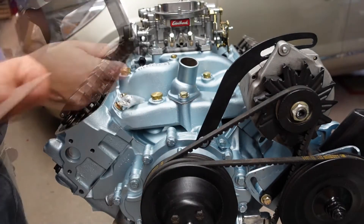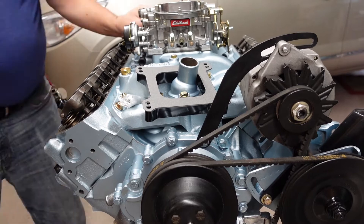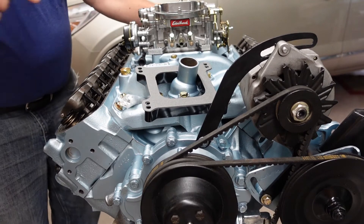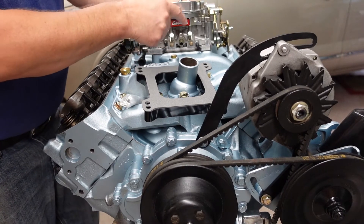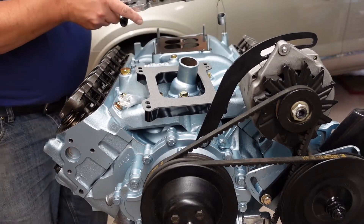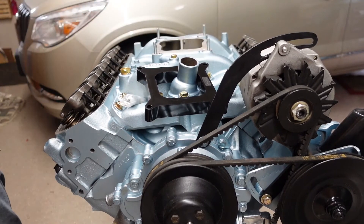That's pretty nice — super smooth on the inside. Let's get this other piece off. At this point it's really important to be careful not to drop stuff in your engine. There are holes in here that actually go down into the engine, so be careful if you have the valve covers off. I already have a plug over the top of the distributor hole. Nothing wrong with this current gasket, but they gave me a new one and it's thicker, so I'll use it and have a spare.